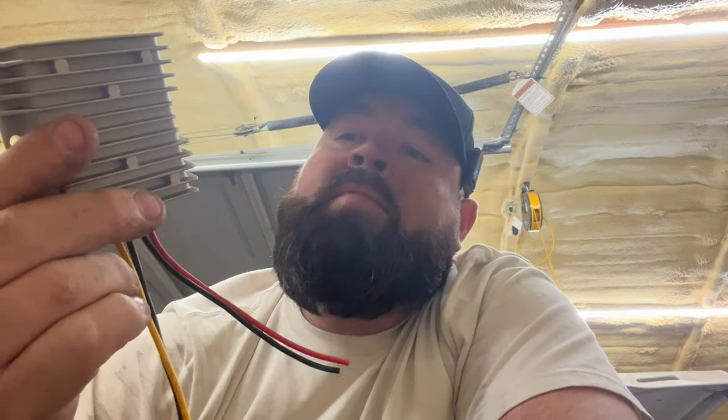So that's why we're going to introduce a relay into the system. This relay here is a 36-volt relay, 40 amps, and we're going to turn this relay on and off with the key switch of the golf cart.